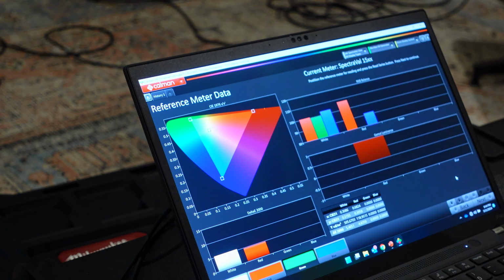It's almost like in an audio situation where you have a microphone set up and you're running tests, and you don't like the results, so you make an adjustment, then you run the test again, and it's just back and forth until you're happy. And this is exactly the same as it is with the TV. So with a proper ISF calibration, your main settings are going to be done. Your white balance settings are going to be done. If the TV has color management and it needs to be adjusted, that will be adjusted. Getting the gamma right, exactly how we want it to be, needs to be adjusted. And some of this advanced stuff is why we have the laptops and the light meters and things like that.